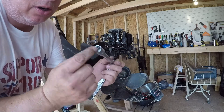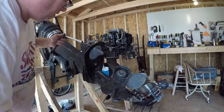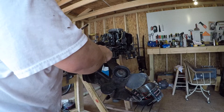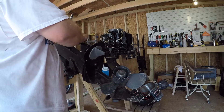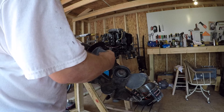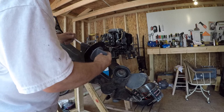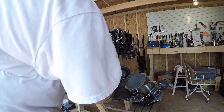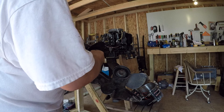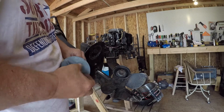So you need one of these — it's a Star Drive, this is T16. It takes off the trim tab, so you put it in there. And if you can get your bolt out, it helps, because then you put it back with your trim tab and you know where it's at.